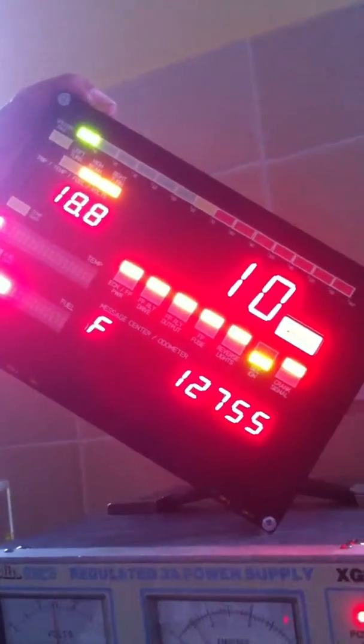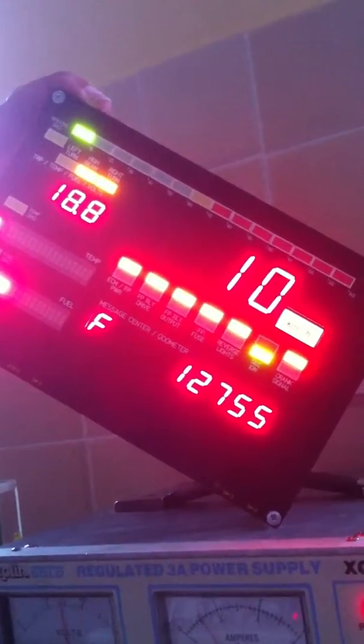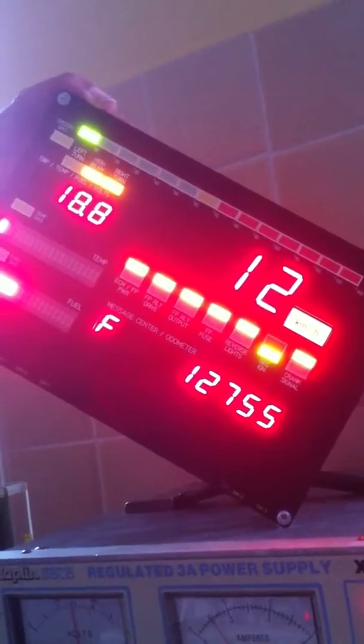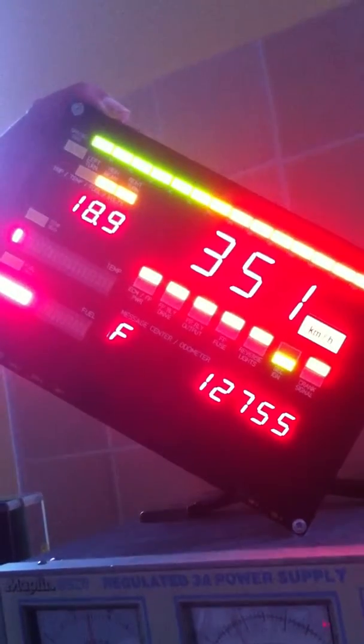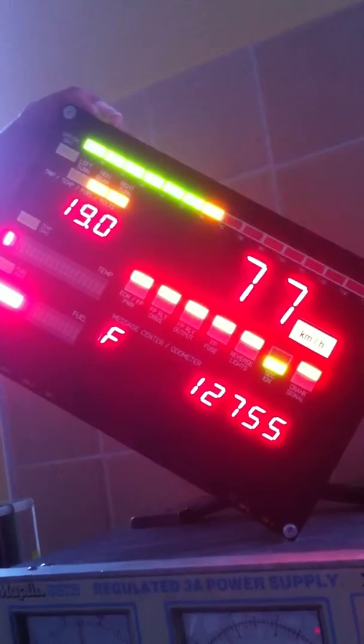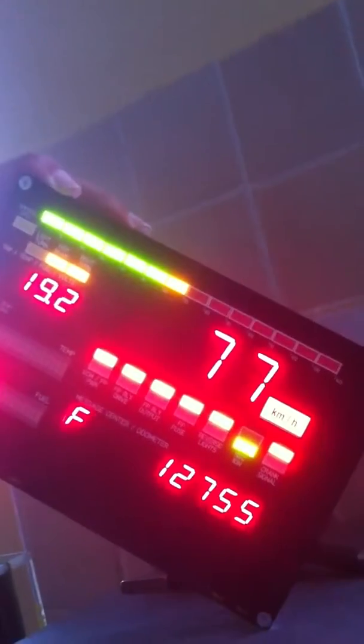running mode. In normal running mode, we see that we have a speed display, which we can simulate the speed on the rig here. We have a bar display and a numeric display. This is normally indicating miles per hour, but this particular module here is made for a customer in Europe who wants kilometres per hour, so that's easy to do as well.